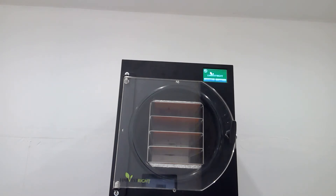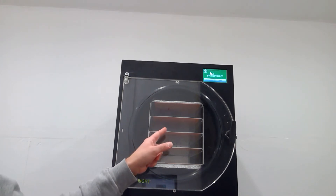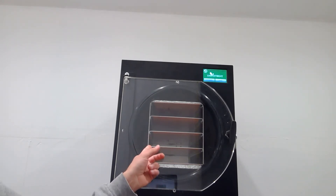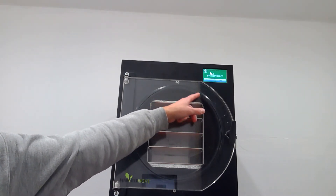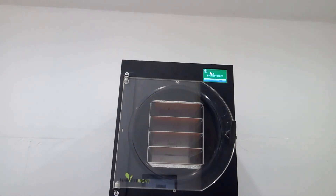When you're ready to go, you load your food into the tray holders and hit continue. Once you hit start for pre-freezing — 15 minutes — you'll open the door, make sure your side valve is closed, load your food in, and then it'll say continue and remind you to check that valve. When you close this door again you want to make sure you see that black line all the way around, ensuring a tight seal. I'm a bit anal about it — if I don't see that connecting black line in parts there's potentially hot air able to get in and cold air able to get out — so I tend to worry about it and I'm just referencing it for you guys.